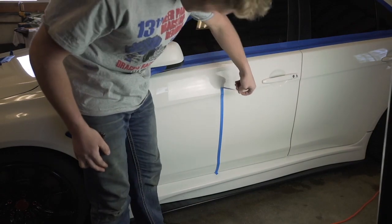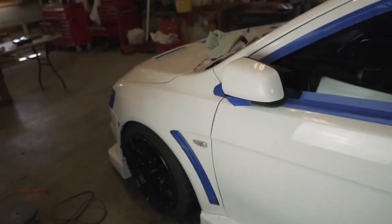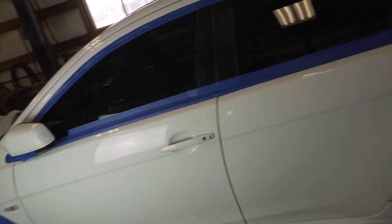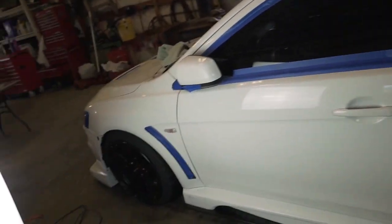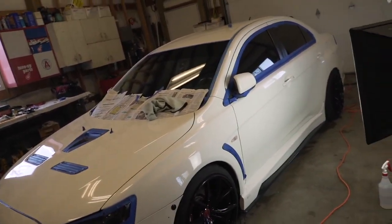Let's tape off, wipe it down, and I'll show you guys the difference. This is definitely not a good light for this, but you can see the line right here — there's a bunch of crap on this side of the line and this side is a lot shinier. You can clearly see the whole line coming down through here. It looks so freaking good now, so much better — I cannot wait to get the whole car done. But what I usually do to save time, I'll run the whole stage one on one side of the car or maybe even the whole car, just get that stage one done so I'm not constantly switching pads. I'll do stage one and then go over the whole thing with stage two. And if it were a black car, I would hit stage three, stage four, and then wax. But being that it's white, I don't think I'm going to need stage three and four because swirls won't be visible on a much lighter color car.